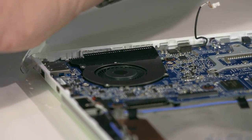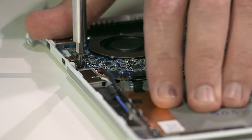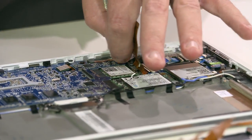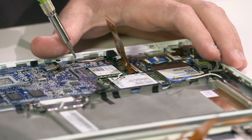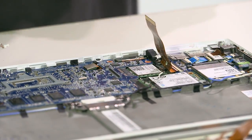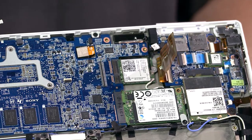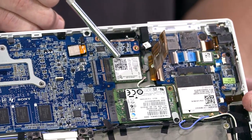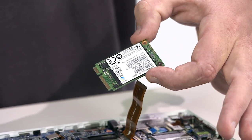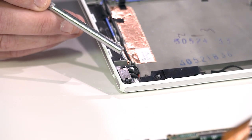On the main side of the tablet PC we have the USB 3.0 and micro HDMI port and the memory chip which holds 4GB of RAM. At the top are ambient light sensors. The NFC chip is located on the other side of the motherboard and the card slots are located right above, along with the volume and headphone jack connectors. Additional screws allow for the removal of the wireless card and the spring-loaded solid state hard drive. The hard drive is 128GB. The power jack is removed through a breakaway design.